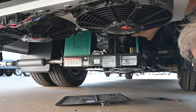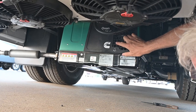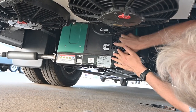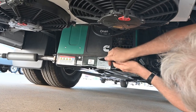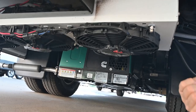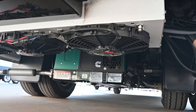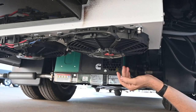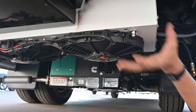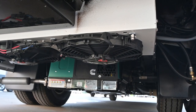There's a start and stop button here as well, and this is the air cleaner — you'll change out the air cleaner when you change the oil for service. Now, underneath here, this has a Pro Air system for the air conditioning in the back of the coach. Driving down the road, it has a separate air conditioner for the house unit that can run off the engine, so I don't really need to run the generator and the rooftop air. But I could run all three — the dash air, the rooftop, and the Pro Air — to super cool everything fast. You have a lot of options in hot weather.